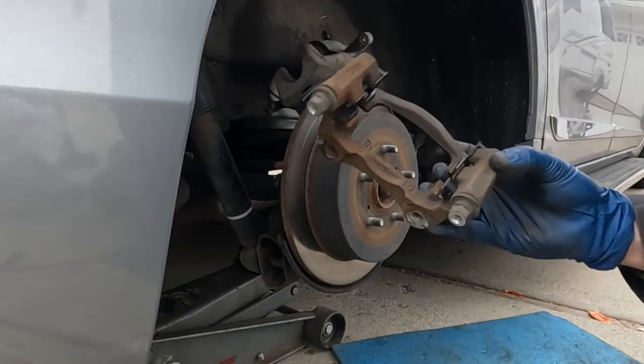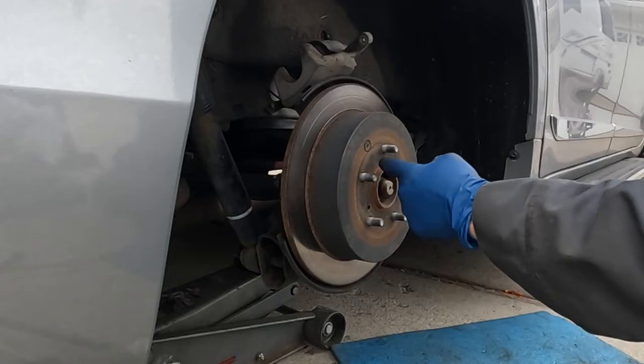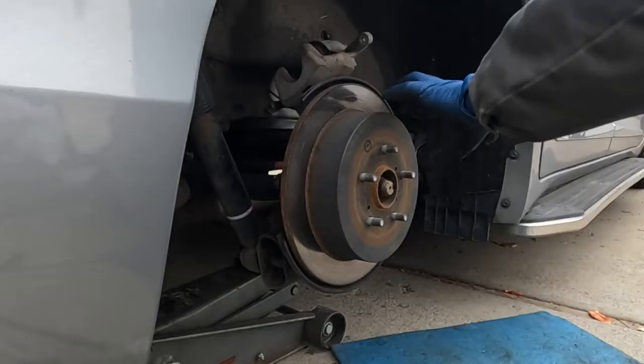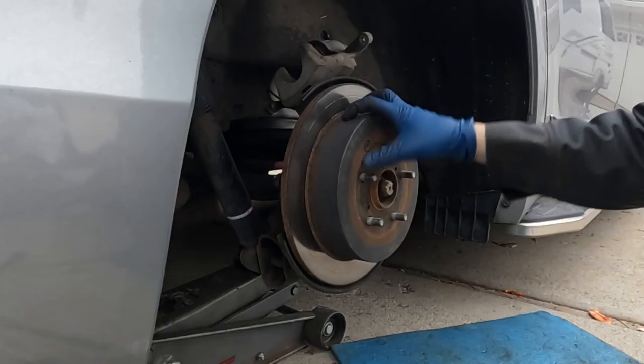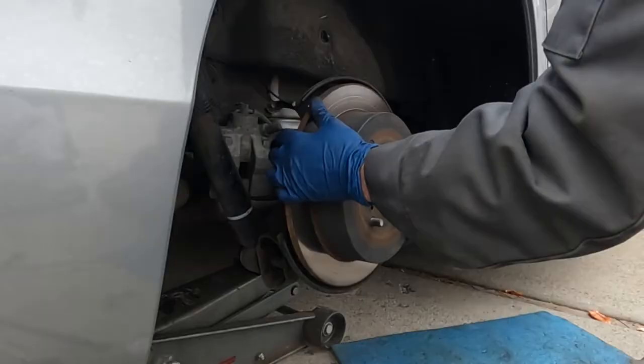Our caliper bracket is now ready to be installed. We're going to be replacing the rotor as well — hammer and just give it a good tap. When you hit on the rotor, just be careful not to nick your wheel studs. Because we're replacing it, you can even hit on the rim; it's okay if you damage it since it's getting a new one. Also make sure your parking brake is off, because the parking brake shoes are under this rotor hat — if they're applied, this won't come off.